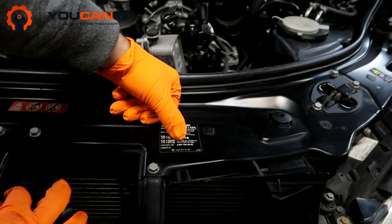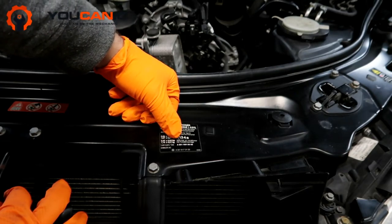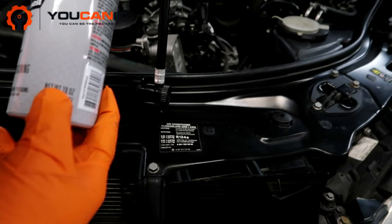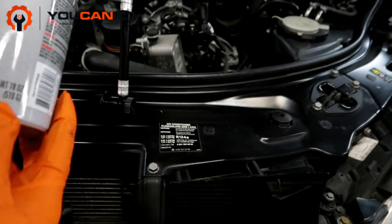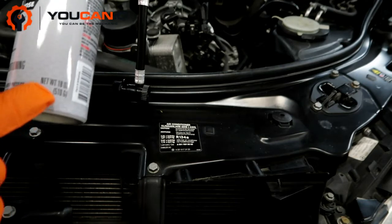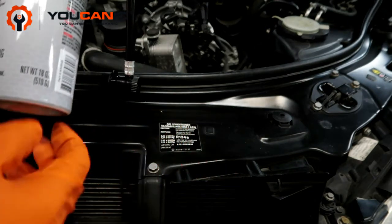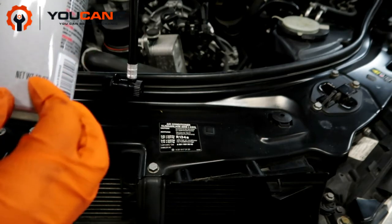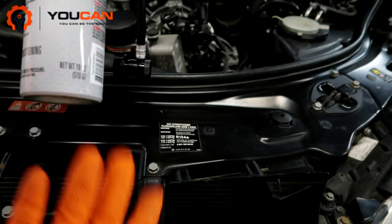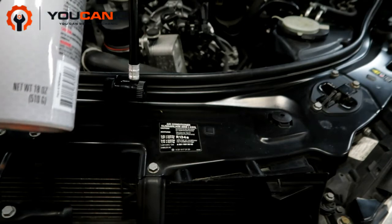That is without rear air AC. If you have rear air AC, it is going to be a little bit more — 2.6 pounds, plus or minus 0.02 pounds. You take your refrigerant and look at the bottom for the weight. This one is 18 ounces or 510 grams. Since this vehicle takes 1.07 kilograms, basically two of these would make 1.1 kilograms if you have no rear AC — so just almost two containers, with a tiny bit left in one. Some containers have 340 grams, so you just have to add that up and add the correct amount.